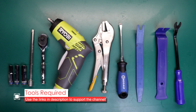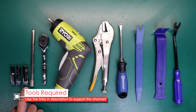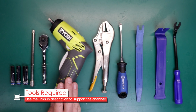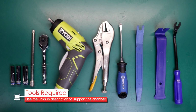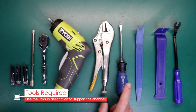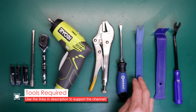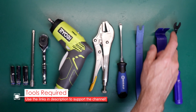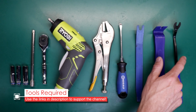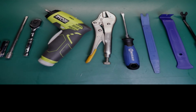For this installation, you'll need the following tools. You'll want deep sockets, 7mm, 8mm, and 10mm. An extension will be helpful to do some reaching. A ratchet, of course, to drive them. But you know I like my Ryobi power screwdriver. It's small, compact, and cheap. You'll want some vice grips when adjusting the tension on the trunk spring. A flathead screwdriver is handy unless your pry tool has a small tip on it. I love this pry tool, I use it the most, but you may need something more substantial like this one when pulling the retainers from the trunk liner, or maybe even a metal one. Links to all these tools can be found in the description below.